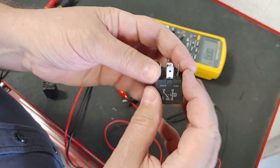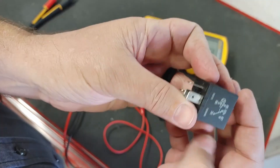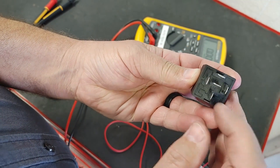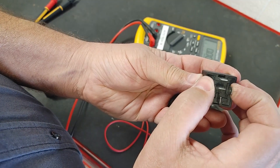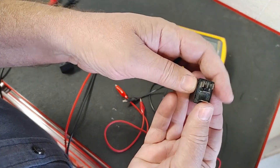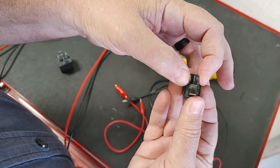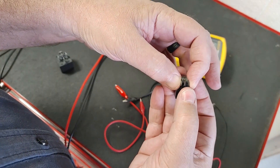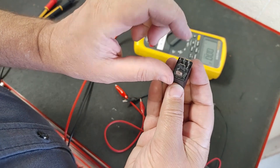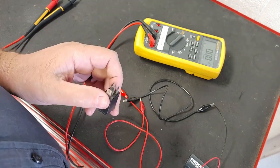One thing — if you can't remember, obviously you have the wiring diagram on the side most of the time — but this forms a cross, so the outside piece of the cross, that's where your control terminals are on these. And it's really the same thing here too: these two here are your control, you hook your battery up to that and it makes it click, and then it's going to be continuity between these two right here. Hopefully that helps.